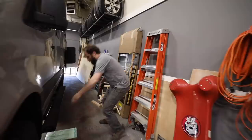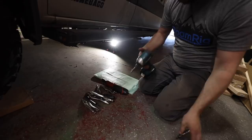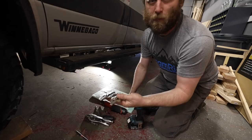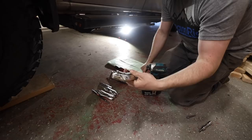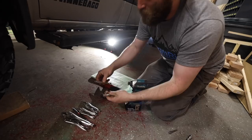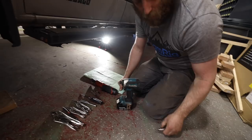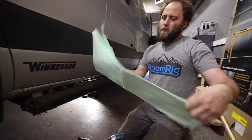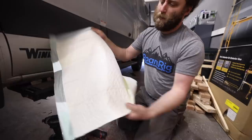I always like to get my tools ready before I start. I'm a fan of power tools — you don't have to use power tools for this. You're going to need a Phillips screwdriver of some sort, two needle-nose vise grips — these are for clamping the coolant lines. Don't use official coolant clamp plier things; use needle-nose vise grips, they're the only thing that works. You're also going to want a larger pair of vise grips, a 7-millimeter socket, a 10-millimeter socket, a flathead screwdriver, and a 5-millimeter hex bit. And I like to have a spill pad — this is a puppy pee pad — it just soaks up the little bit of glycol that you're going to spill.